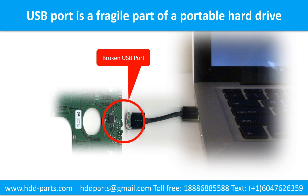One side of the connector is a heavy hard drive, relatively to the thin PCB board. The other side is a fixed computer. The connector is like a fragile bridge in between. Also, every time when you use the portable hard drive, you need to plug and unplug it. Sometimes the power connector is broken, but most of the time it's the USB port that is broken, and most likely the broken part is the thin PCB board inside the portable hard drive.